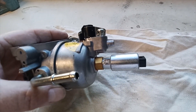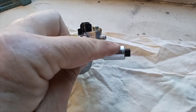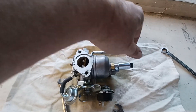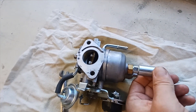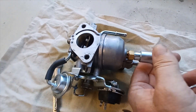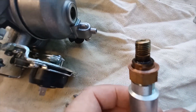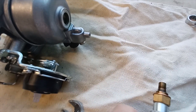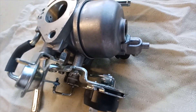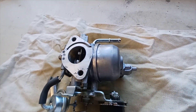There's an electronic solenoid at the bottom connected to a wire harness — this silver cylinder here. We'll take that off and then take the brass fitting off the bottom of the bowl and drop the bowl. It's metric of course. I put the wrench on the solenoid and the brass fitting is coming with it. Oh yeah — we've got some gunk on the bottom of this thing, a lot of junk. It didn't smell like stale old fuel, but let's get the bowl off.